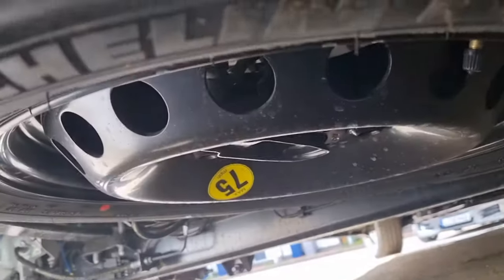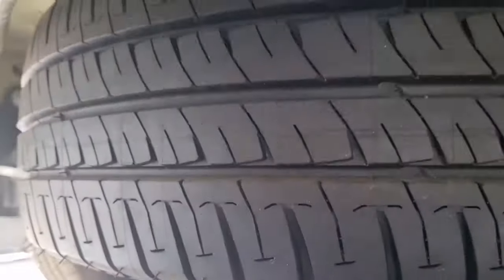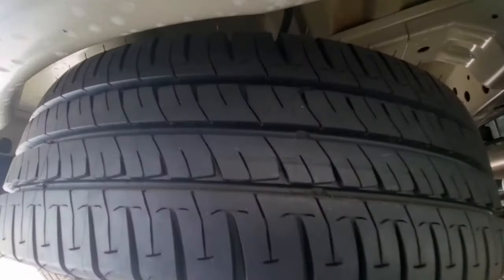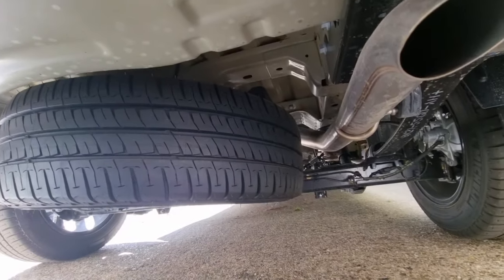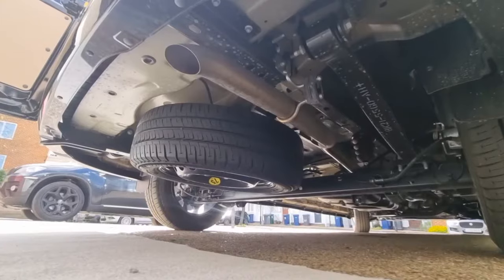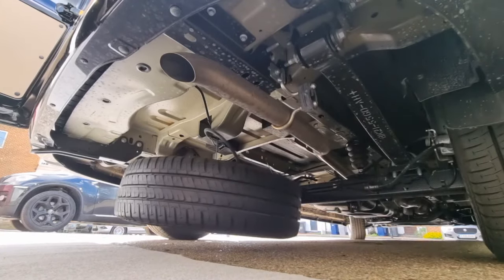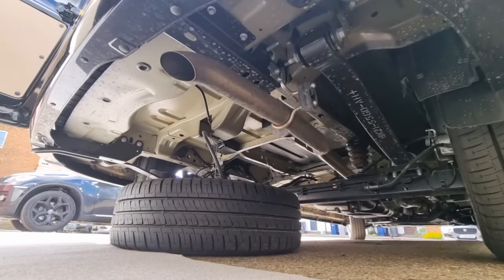Let's have a look underneath. Never play with the bolts here — there are a couple of bolts but those come in a later explanation. You can see it's hanging now — simple as that. Undo from here and the tire keeps dropping. There's a wire connected to it, so undo it all the way. If you've got a puncture tire, replace it; if not, keep it at the back of your van, nice and safe. Keep undoing it and you'll see how it drops — one, two, keep going — she's out, simple as that.